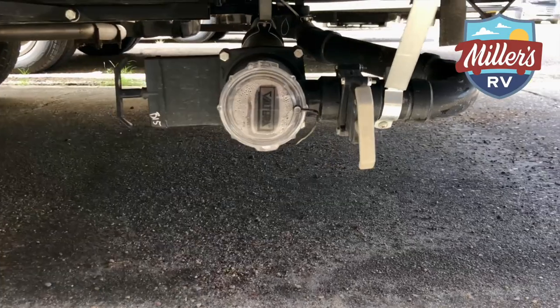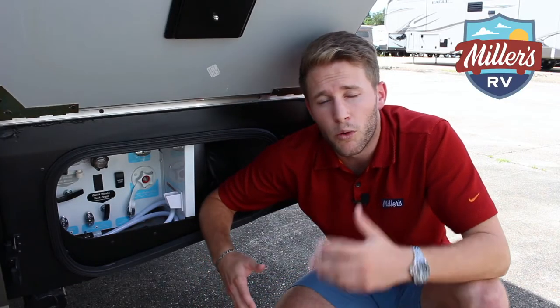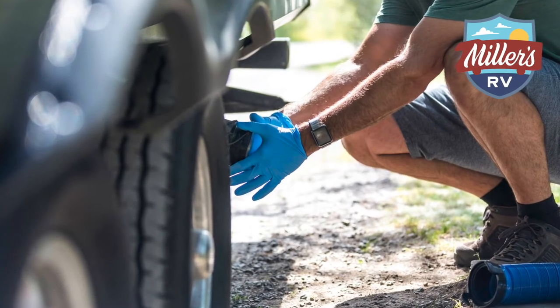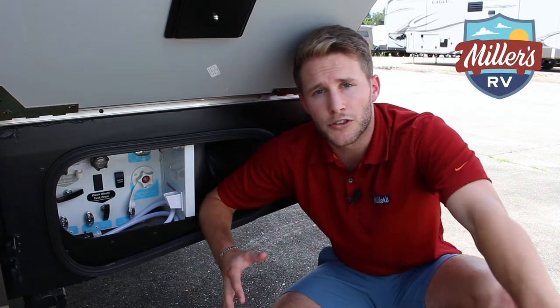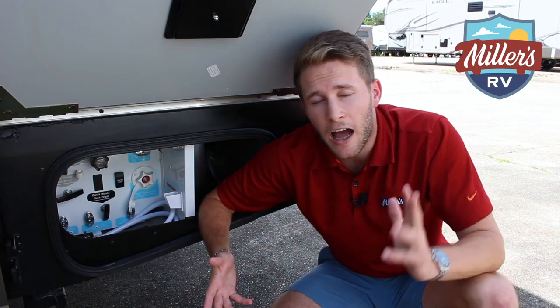It's very easy to tell which one is which. So just a little run-through of how we like to dump them. When you go to dump your tanks, we always like to dump the black tank first — get our nasty stuff out. Then after that, we use the gray tank, which is still dirty water but it's not that gross clumpy stuff. So you let the gray water wash through everything, kind of clean out the pipes a little bit and wash through your sewage hose as well. It's really easy. I advise wearing gloves.